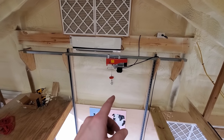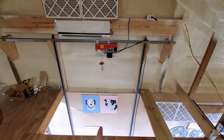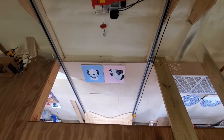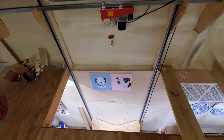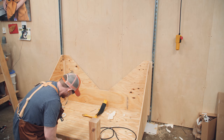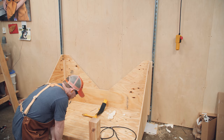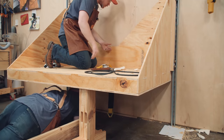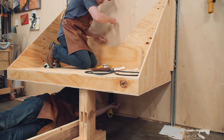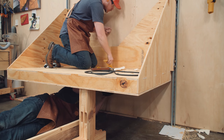I have not tested this yet, so I'm going to go down below and see if I can turn the breaker on and drop that down. Then I can just connect all the dots downstairs to get this thing working. Very little work left to do. This is when I realized I forgot to install the lifting strap before bolting the lift in place. So I had to use a pry bar and a bunch of blocks to get a mechanical advantage to lift it up off the floor enough to gain access to the bottom. Then I could fish the strap through. I used 50 pound fishing line to help feed the strap around the back of the platform.